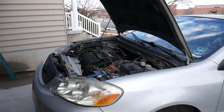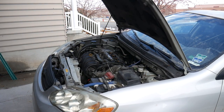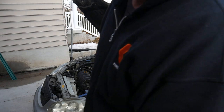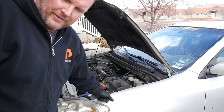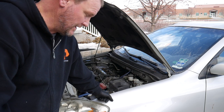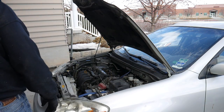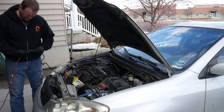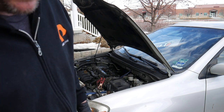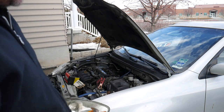Alright, let's fire this thing up and see what happens. Any bets? I'm going to put it back on the ground first. Battery's dead — wouldn't you know? Somebody opened the driver's side door and the trunk this morning, rooted around inside the car, and left the door open. I'm hoping that's why the battery's dead because the dome light was on. Grab a charger, plug it in and see what happens. Battery was down to 9.1 volts. While the battery charges, I'll get the pretty cover back on.